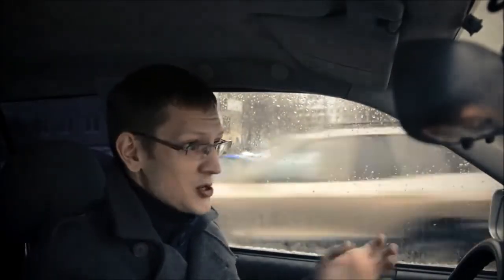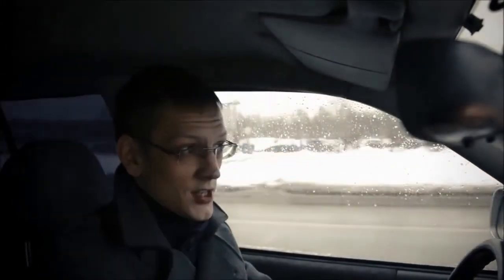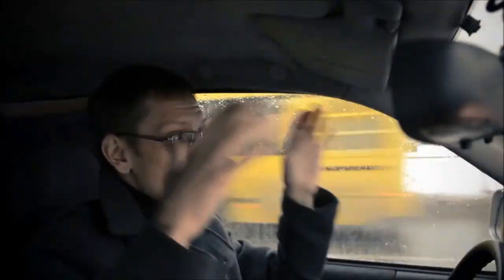We will show what happens with that damned Range Rover and why it still drives on the same oil. Nothing changes, and it seems normal, right? It's a crazy thing. You'll see everything in the following videos. And I suppose that we will make some videos to explain how oils are dying. We will not compare oils and tell you just marketing slogans. We will show you what happens with oil after 5,000 kilometers run, which oil still performs well and which loses its properties, as our Castrol, when HTHS dropped down to 2.3 after 3,000 kilometers run. That is much lower than minimum 2.9 according to its characteristics.